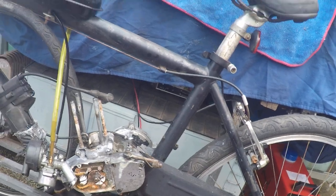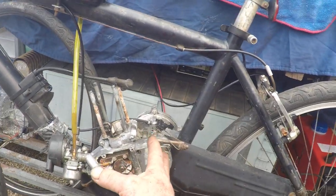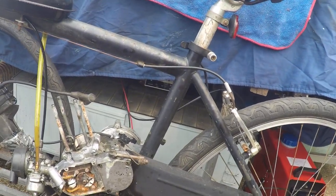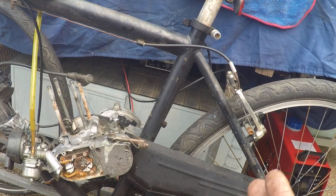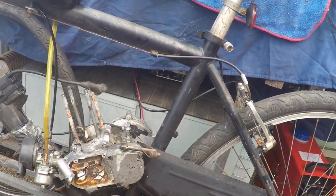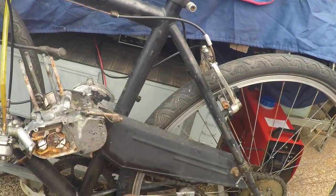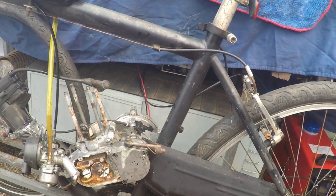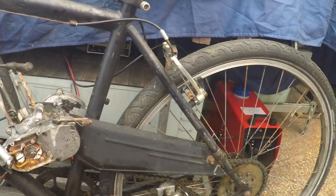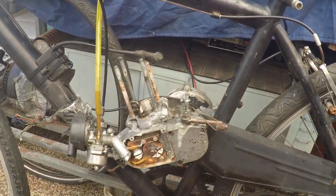No pipe's going to fit straight on a bike unless someone's tuned it for it. So whatever your engine is, how you can tell is where your band kind of picks up. If your band's picking up high, your pipe's a bit short, you can lengthen it a little bit here. And if your band's cutting in too low and you've got no top end and she's four-stroking at low revs, then you're probably a bit long. But if you look up some diagrams on how to tune a pipe, you can find all that on eBay. But anyway, that's about it.